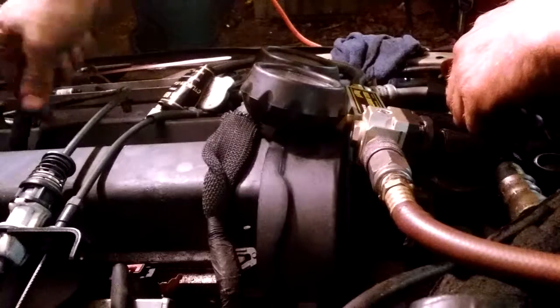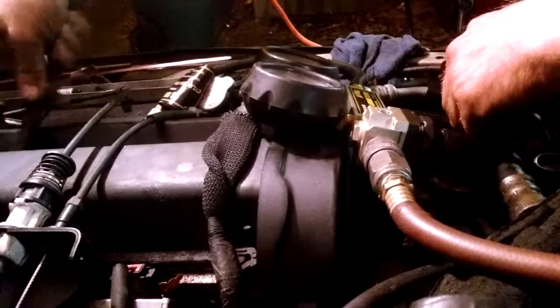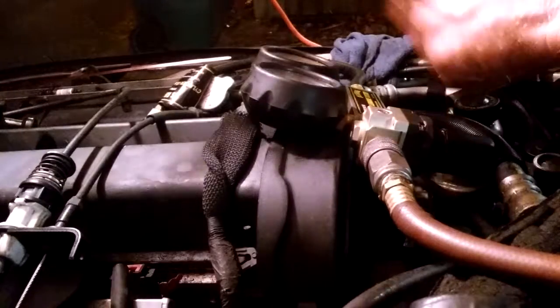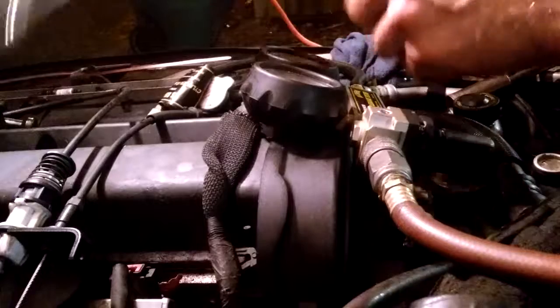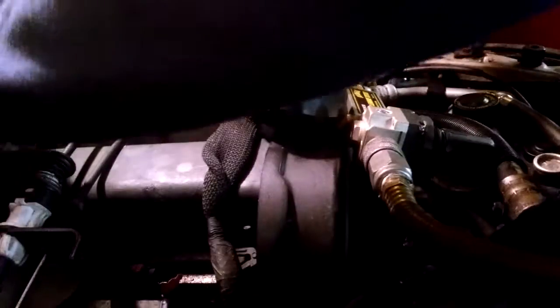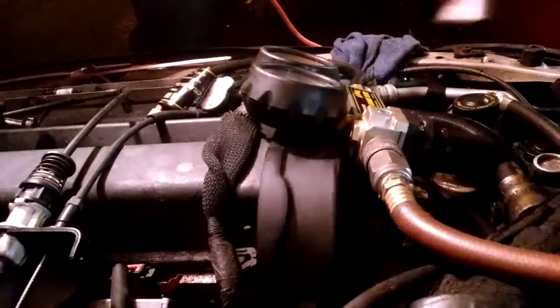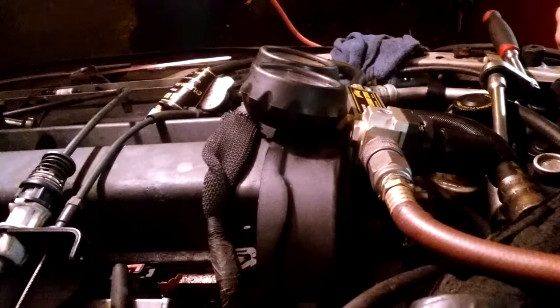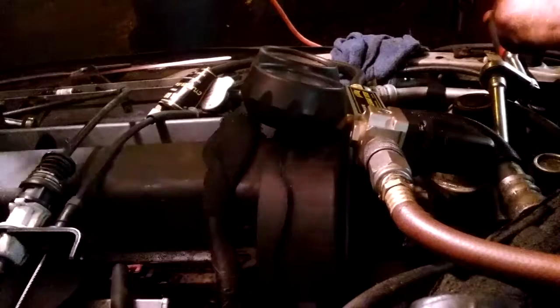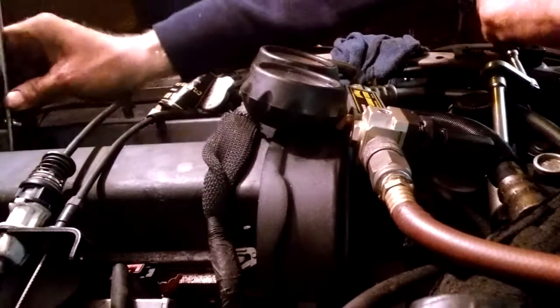Disconnect it because you don't want to leave it, it's going to take your air out, your compressor. Just keep it running to throw the air in the cylinder. So we're less than 10%, we're fine. So that fitting got stuck in there again, which is fine. Take my ratchet, 3/4 inch ratchet. And actually, this leak down tester didn't have this adapter I needed, so I'm using one of my compression gauge tools, which is fine. Compression gauge tool is just the one I like, came from Sears. A lot of automotive shops sell the same one.